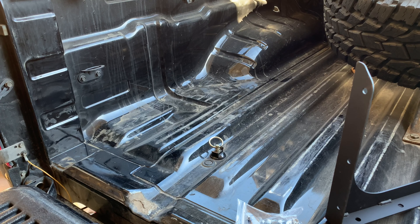I'm going to do a quick mock-up and mark these with silver sharpie — I might mask it off just to get really clean lines. I'll line it up here, away from the seam, so I'm not drilling too close to it. I'm going to have the bolts face inward. Facing outwards might look cool but this is probably the cleanest way to do it. There is a spot weld right there — I don't think it's a big deal if I drill through it and run a bolt through it.